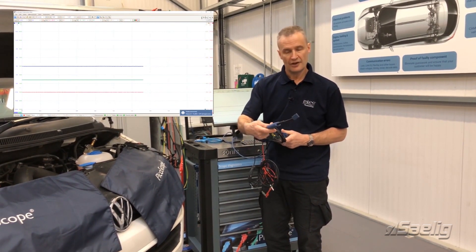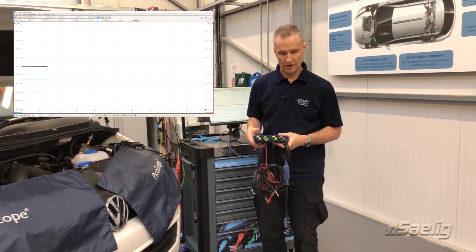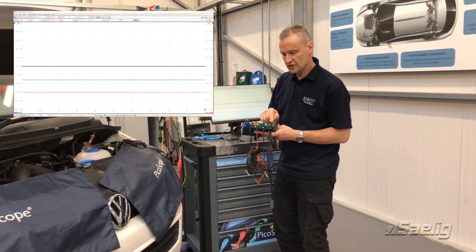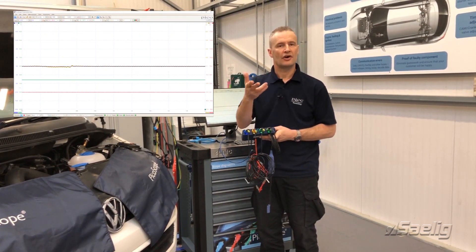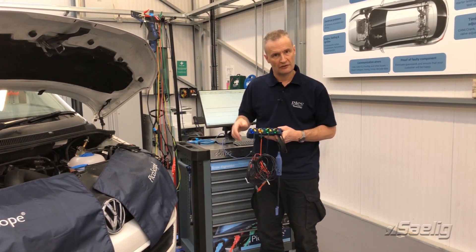Another accessory we're all familiar with is the coil-on-plug probe — no different other than it now has BNC plus, so there's auto probe recognition and it sets the scale range accordingly. The LEDs have responded to the shell color of the relevant probe, and it's selected a millivolt scale because we're reading the low-voltage interpretation of the field around the coil.